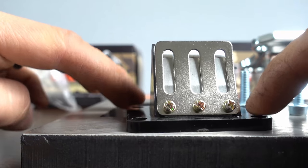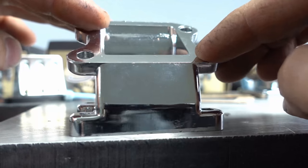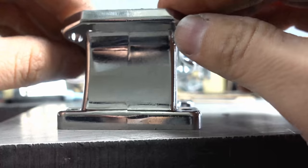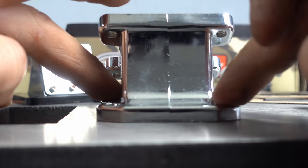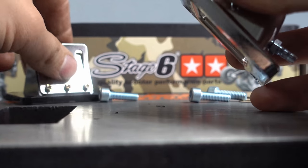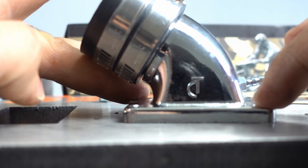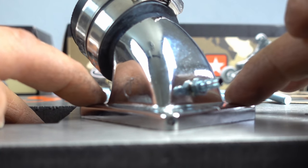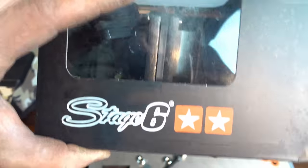Here's our reed cage — the Honda Dio, Honda Elite. You've got the base of the intake manifold. Metal on metal — hear this? This guy's also not true. This is a surface that's going to sandwich your reeds, and that may be the worst of all actually. This is the part that goes in your reed cage, this connects to your carburetor. We're going to rock this guy back and forth as well — that guy's pretty bad. We have our winner or our loser. Let's go ahead and get to the Honda Dio Elite style intake manifold and see how true this guy is.